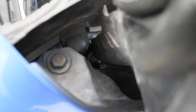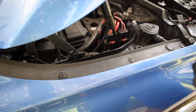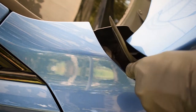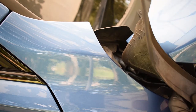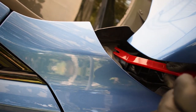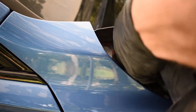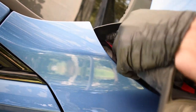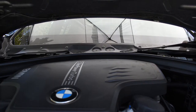On each side, these are the last pins holding in the windshield cowl. You can remove this weather stripping — I found it was a little easier and gives you more room to get a trim tool in there. There are just push pins; you pull up. Once you peel this back it'll make it a lot easier to fit a trim tool in there and pry up the pin. Once you do this on each side you'll be ready to remove the cowl.